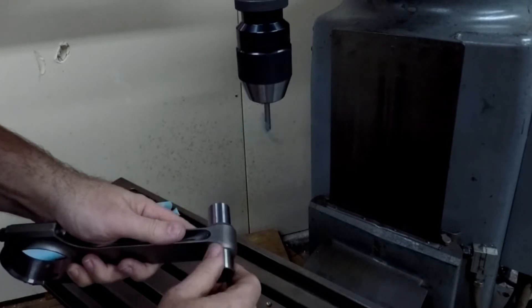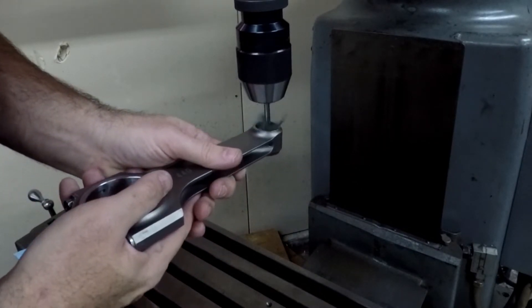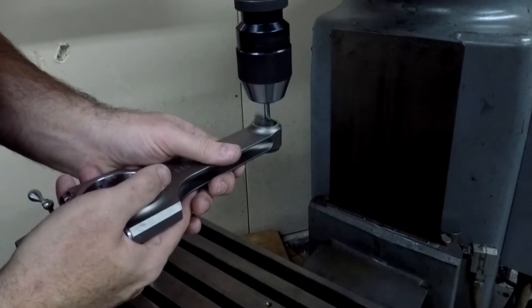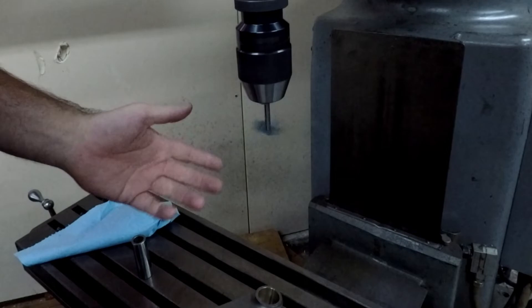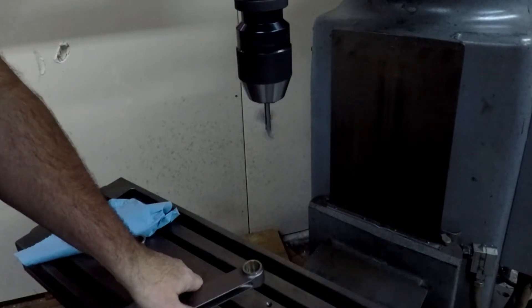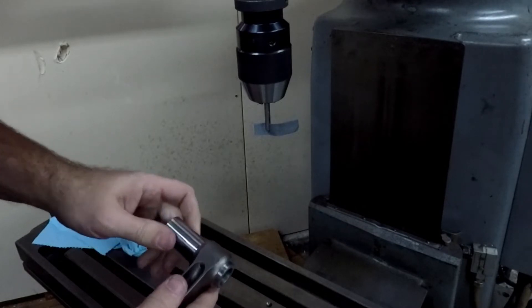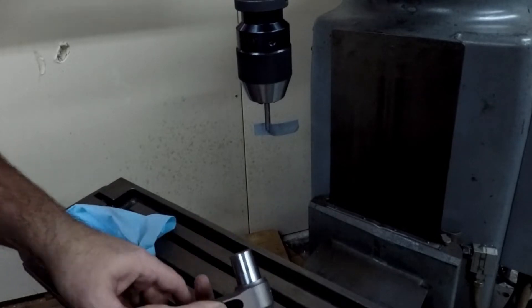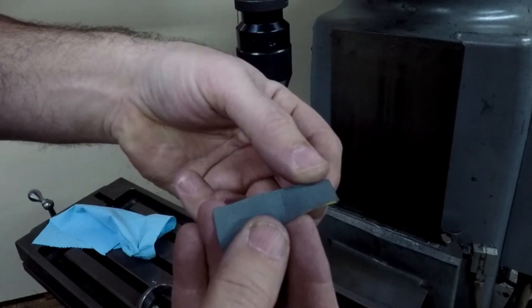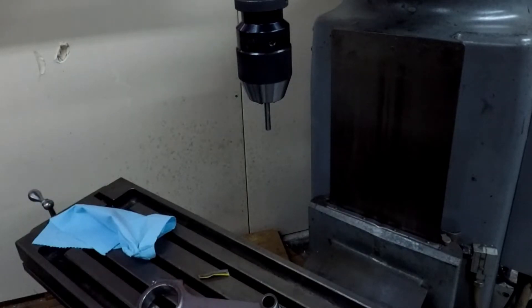It's already sliding a lot better — let me give it just one more quick little pass. Okay, and this is safe — it's just 2000 grit sandpaper, if you get your finger in there it's not gonna hurt you. So it's a good idea to be a little careful but let's not go crazy about it. See, that slides in there real nicely now — there's no play, no rattle, no slop. It didn't really take off much material. We're looking to just buff it a few ten-thousandths of an inch.